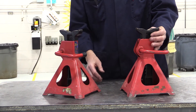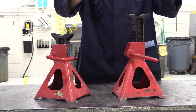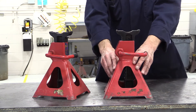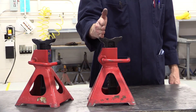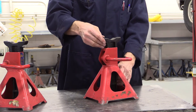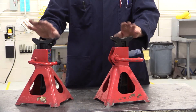Some folks just need a little orientation. As you raise the vehicle, these are adjustable. When you're done servicing it, lower it. The most important thing to point out is when these are placed under the vehicle, please put the weight in the center of the jack — not over on one edge. I've seen jacks, especially if the weight is coming on an angle and it's out on the edge like a control arm, these have been known to skip out or pop out of the way, and of course that's never a good thing.